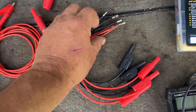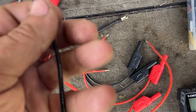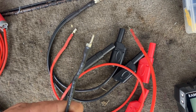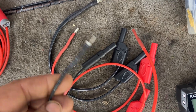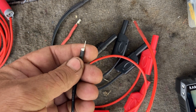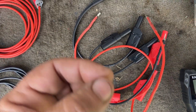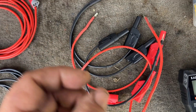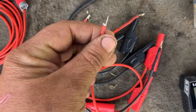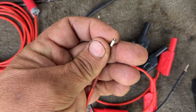First, I want to go over these — I've started building these. So when you have a wire that you need to probe into, you can use this. You don't want to stick a big old probe down in a wire and spread those terminals out. But it needs to be the right size, not too small, because then it makes intermittent contact. These will actually allow you to probe onto those. These are from a GM ABS sensor.